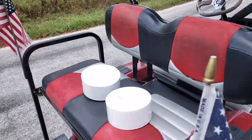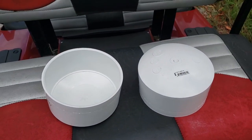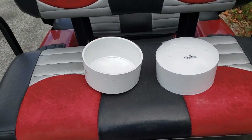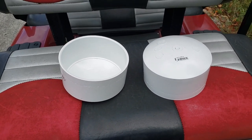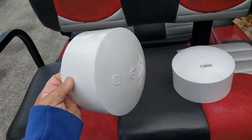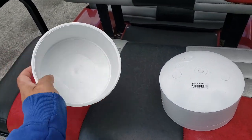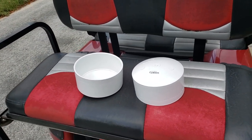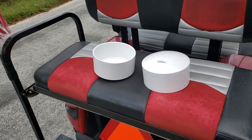What we're going to do is show you how to take these and turn them into speaker pods. Basically, these are just sewer caps — you can get these at your local hardware store or online and have them shipped to your door. They take quite a bit of work to turn into pods, but at the end you'll have an awesome set. These things are quarter-inch thick — they're not going to break. They make absolutely perfect speaker pods for six-and-a-half-inch speakers.